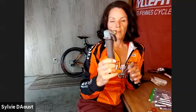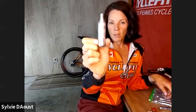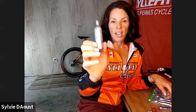Remember the story. So with regards to these, make sure you get the adapter that has like a control valve. And the reason why I say that is because it is about 90 PSI, and you want to slowly add air into your tire and check it as you inflate your tire. And I'll talk about that in a sec, like later on.